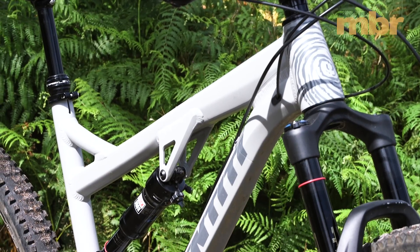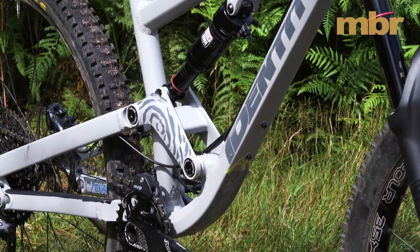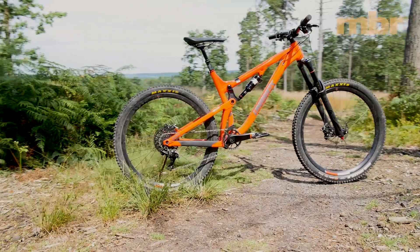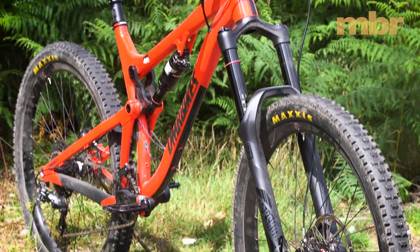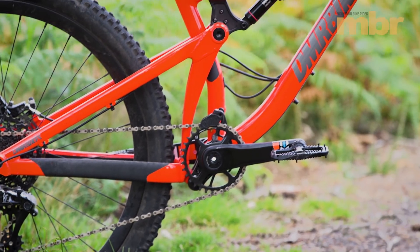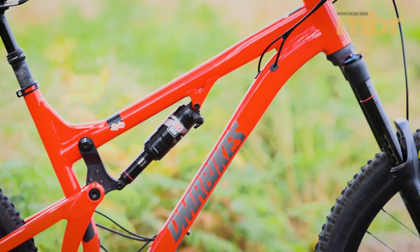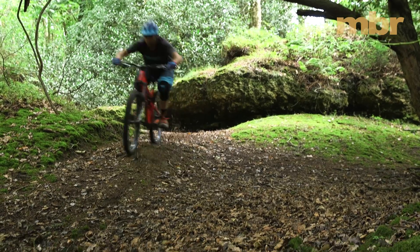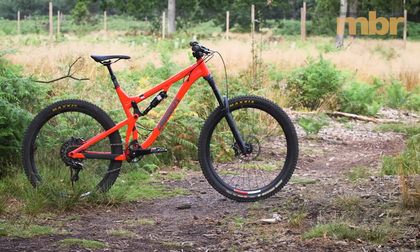The cable routing on the Metal isn't the neatest, but it's unobtrusive and at no point does it detract from the ride. The alloy sled isn't DMR's first foray into the suspension bike market, but it moves the game on considerably from the old steel bolt. With a definite resemblance to a Santa Cruz, it also shares a VPP configuration and counter-rotating links, so the Virtual Pivot migrates forward as the suspension compresses, and it's all tied together with sturdy collet hardware for maximum security and minimum maintenance.